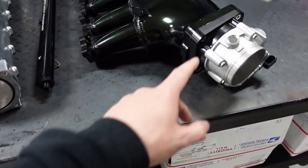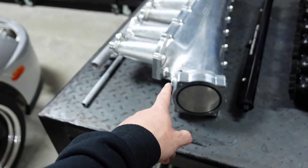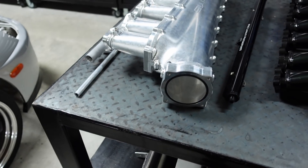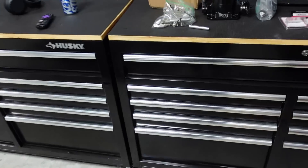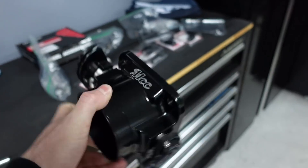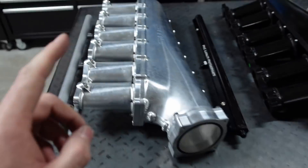Let's start with the MCC — you guys have seen it before. I did opt for the adapter on this one. The MCC will come with a throttle body; the SMS will not come with a throttle body. He'll make an adapter that comes with it for drive-by-wire, but no throttle body — that is extra cost, which is included with MCC. It will come with a mount so you can put a Toyota TPS on it; in my case I put a GM one on and adapted that.